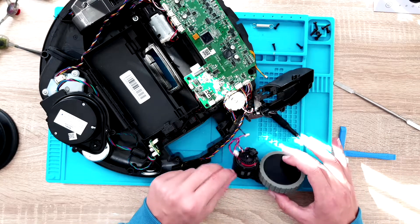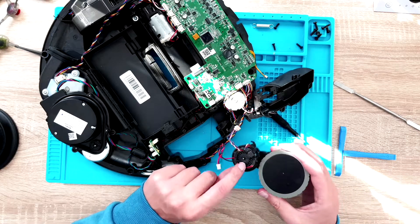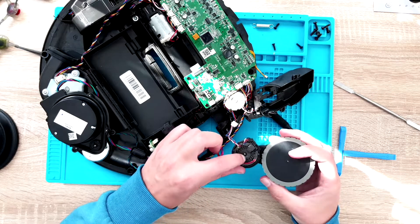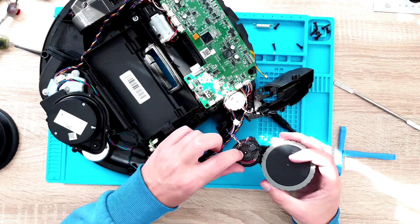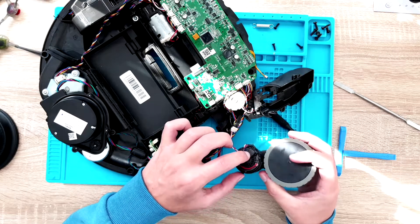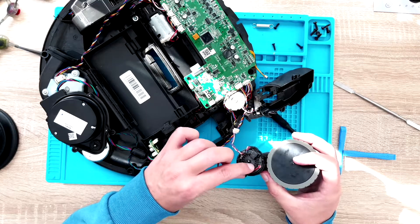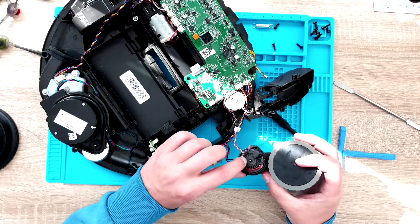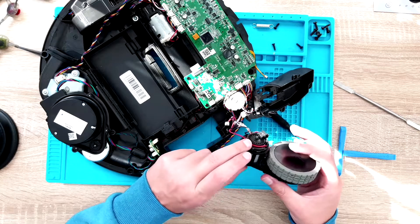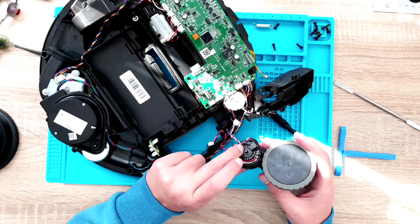Now I've cleaned it up. What's interesting - there's a gear-like thing here which is basically a rotation sensor, I assume a Hall sensor. It detects the spinning speed, rotation, or angular velocity of the motor. From that they can calculate distances and things like this. Let's take it apart and see where the damage is.